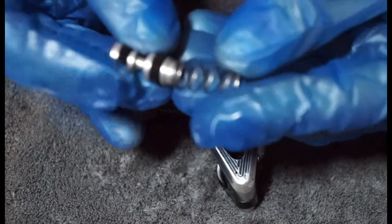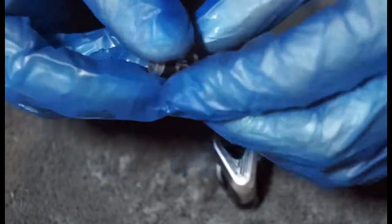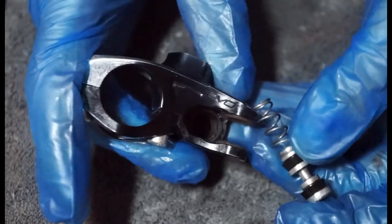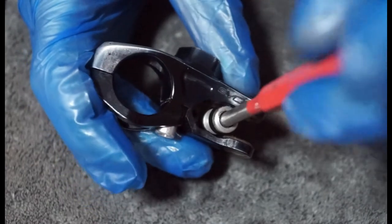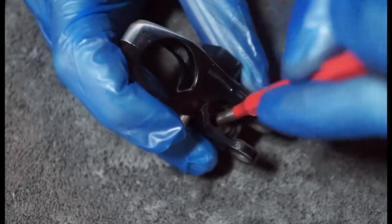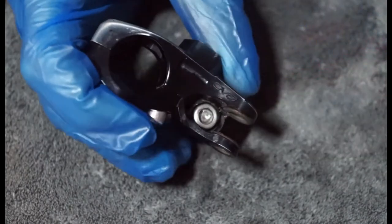Regardless of the piston damage, we're going to put it all back together anyway, just to show you. It's a very quick and easy process from here on in. Put the spring back on. If you want, you can put DOT fluid on these seals when you put them in — it doesn't really act as a great lubricant, but it's better than nothing. If your seals are in good condition, they'll just slot down there anyway. Give that a little wiggle, then move it back and forth and make sure it's nice and smooth. Everything seems all right even though it's got that mark in the barrel — it seems pretty smooth.